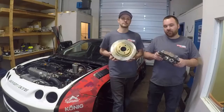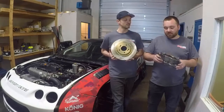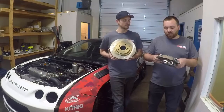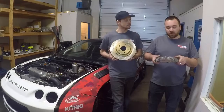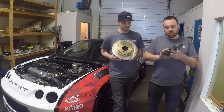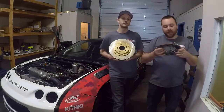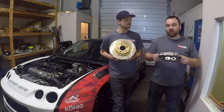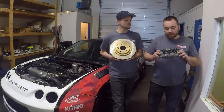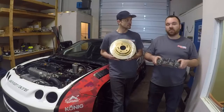This is their Gen 5 competition caliper, called the C43 caliper. It's pretty amazing. The StopTech line of trophy calipers is already very impressive, but the C43 has gone even one step further with mainly the weight reduction. There are holes machined everywhere, and extra gaps in certain areas for venting. This caliper, compared to the one we ran last year, actually has a 2mm larger front piston, so that should help with the brake bias. I'm super excited to be using this caliper in 2018.